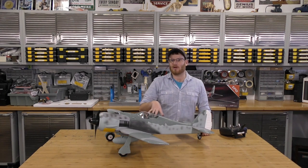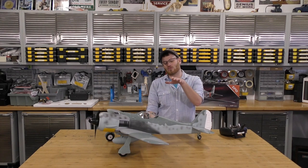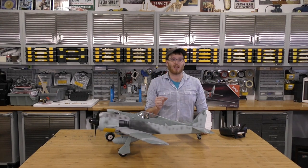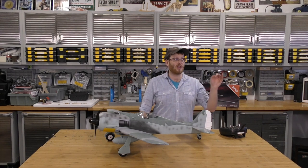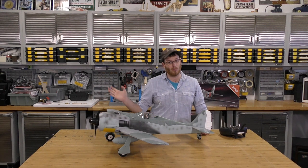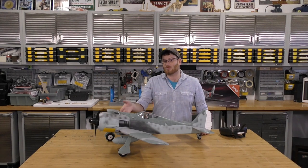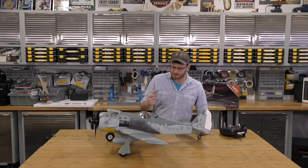And that kind of brings me into my next part: the wing screws on this, the screws holding the wing onto the back of it. They're overall a very small diameter and long, and they are not a standard Phillips. I don't know exactly what they are, but using a very high quality Phillips driver, they were not biting in as well. I was slipping on them, which is terrible. That means I'm going to ruin those bolts, and they aren't a standard M3 or M2 bolt. They are a coarse thread long bolt.